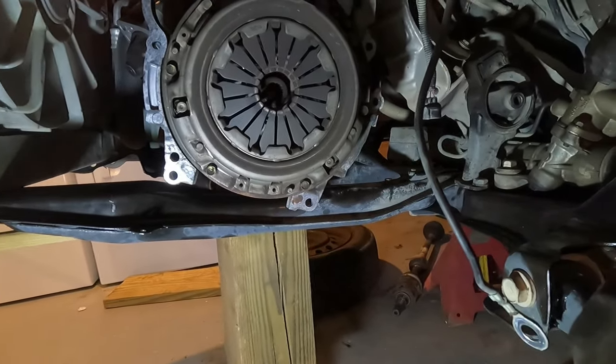The main thing when you're putting it in by yourself: on that back side you want to tilt it up and make sure you get over that rear motor mount before you try to go in. Once you get it up there you'll feel around and it'll clunk right in. Got lucky and didn't have a whole lot of problems with that. Got my bell housing bolts in - going to start working on the back motor mount and other motor mounts.